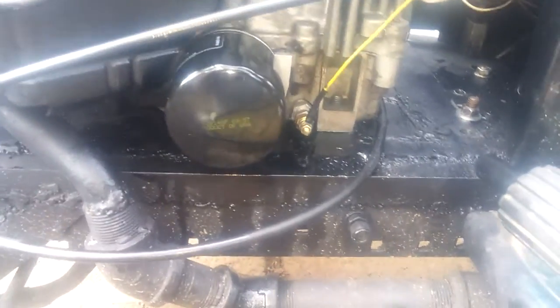Like I said, the only way that this would work is if you knocked off that fitting and it was flush, then drilled and tapped it. Let me show you the kit I did get — it's a used kit, so I'm not going to show too much, my address is on there. Basically this side has the gasket and that's supposed to sit flush to the engine, or flush to the oil filter plate. Then you have this piece right here that holds it on. I figured okay, I'm going to test fit this and see if I need clearance. Good thing I did because this piece is the same size as the filter.